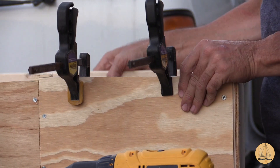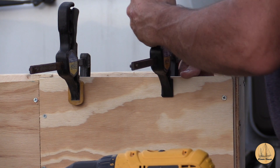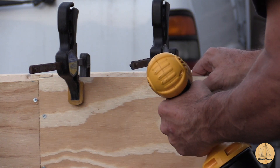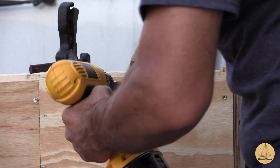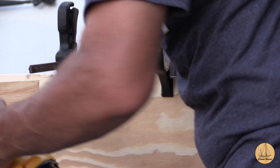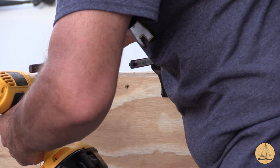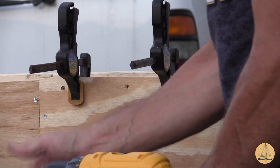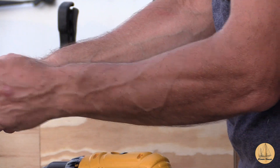I have this really convenient bit — it's a quick bit where on one side it's a drill with a built-in countersink. The beauty is it's got a little locking mechanism: basically just slide the locking mechanism out, flip the bit over, and on the other side of the bit is a built-in Phillips screwdriver. So it allows me to quickly run a screw into these and get them countersunk right to the surface. Then we're going to repeat the process on the other side as well.